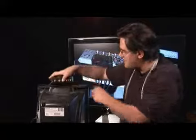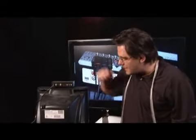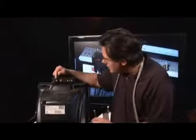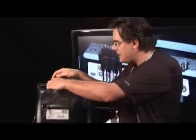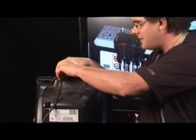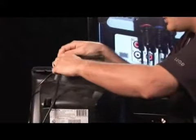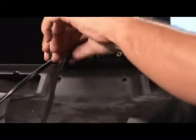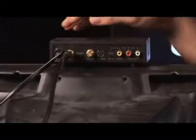So we get that, we plug it in, put it on top of our television here. First, we're going to take our coaxial line starting from the modulator going to the TV. We simply place it in the center and screw it in, get it right down in there, a couple of good turns until it's nice and tight so it doesn't fall — we're good to go there.